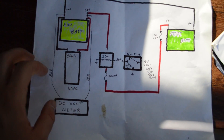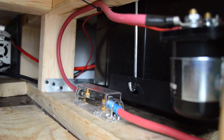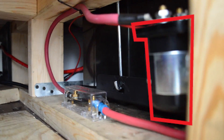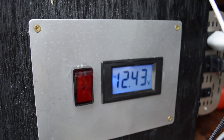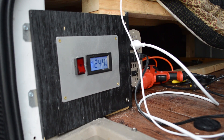which I actually digitized and I'll be putting a link in the YouTube description if you want to check it out. So it's a deep cycle battery connected to an isolator and a switch, which is connected to the engine. Every time the engine is turned on — so I turn on my key — the connection is turned on to the auxiliary battery, so now the engine is charging the auxiliary battery.